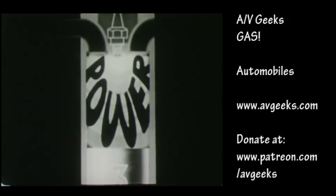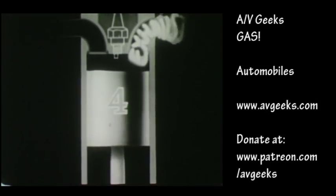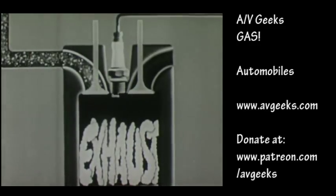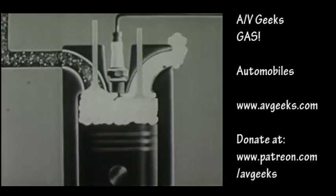Well, that's what happens over and over again in every automobile at the power stroke. The gasoline and air mixture explodes. Now the engine is ready for its last stroke. To prepare the cylinder for the next intake stroke, the exhaust valve at the top opens. The piston moves up and pushes out the burnt gases.